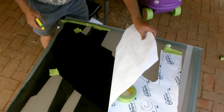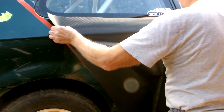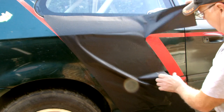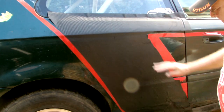And if it folds over — and I have picked the windiest day of the year to do this — it won't stick to itself. Water allows you to place the vinyl on the job and move it around and position it. You've got to get the air bubbles out. You start in the centre of the piece that you've laid. The best tool I've found for this is just a credit card. You just work the water to the edge of the job. You can see the water coming out there — no air bubbles.